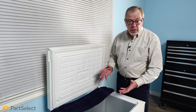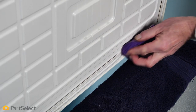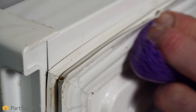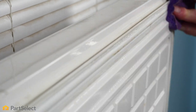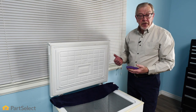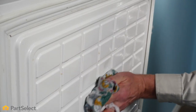Now that we've done an initial inspection of the gasket and lid liner and determined they're okay, we'll next set about cleaning it. Again, we'll use something as simple as dish detergent and water, or you can use a spray-on type of cleaner with either a rag or a soft sponge. Clean the entire surface of that gasket, and once we're satisfied it's nice and clean, we'll turn our attention to the actual liner itself and give it a good scrubbing.